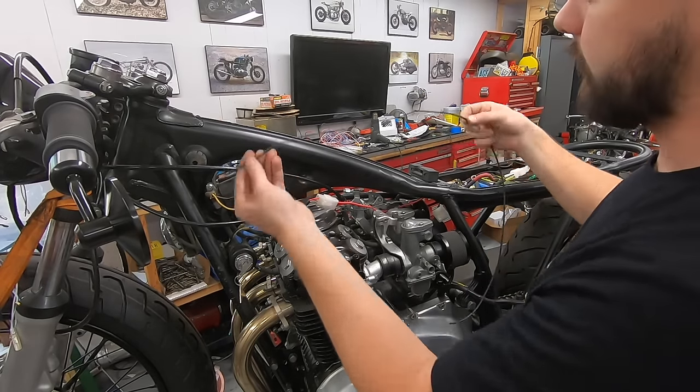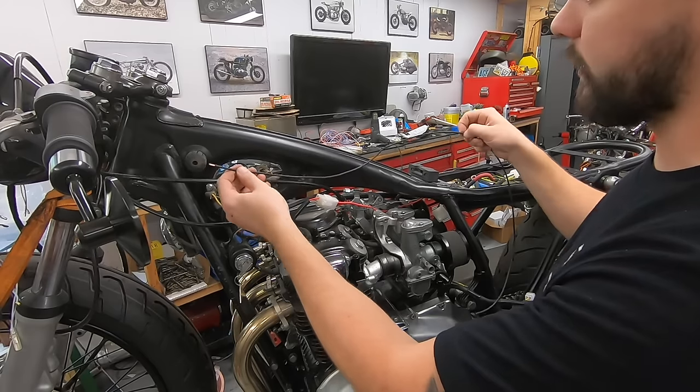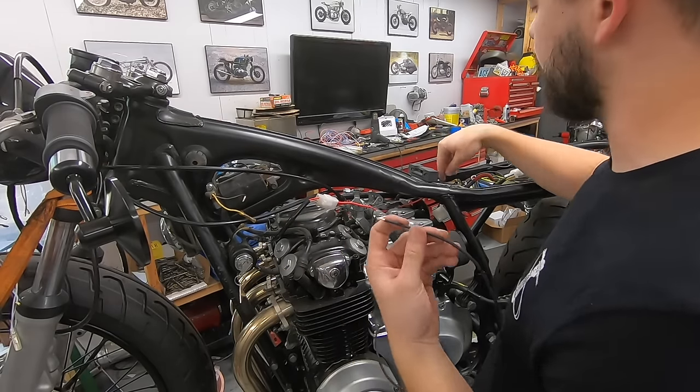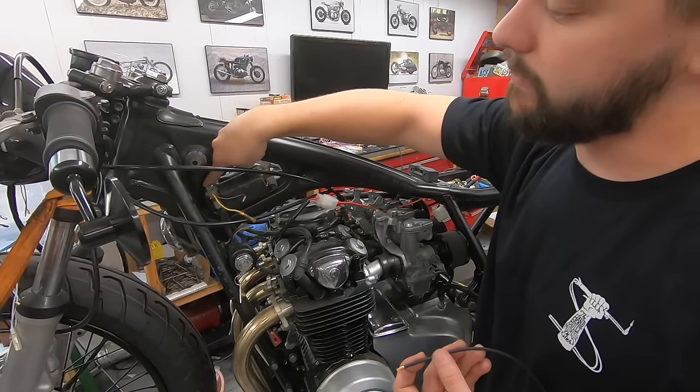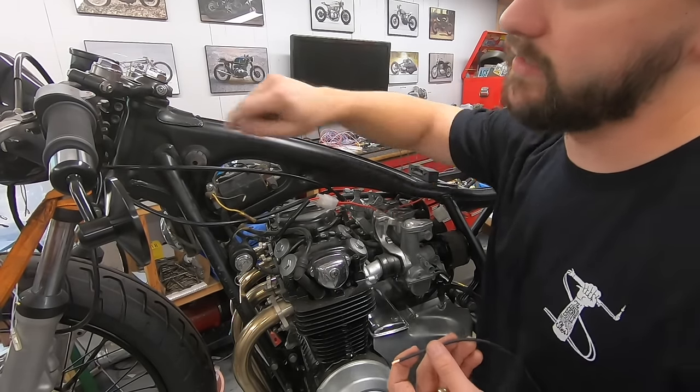What I'm going to do is run off the ground lug of the M unit up to the bolt in the front part of where the coils mount — this is where there's actually a big factory ground. That's going to be a nice place to not only ground the coils, but also add an additional frame ground. And then I will run another ground wire from there up into our headlight, where we can start to branch the ground out via our little wiring connectors.